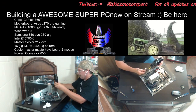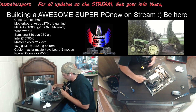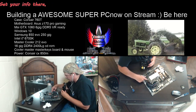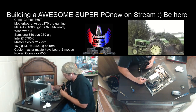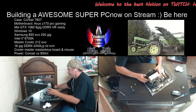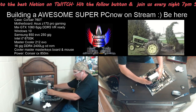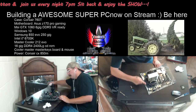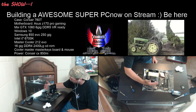Now, this is going to connect to the motherboard right here, next to the processor. This is the CPU fan, but we won't connect it right now. We're going to insert our fan back onto our master cooler like so. Looking at the direction again and making sure we spin it and feel air flow through the radiator.